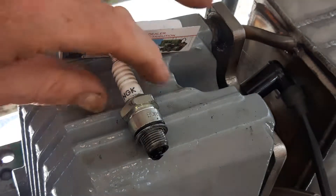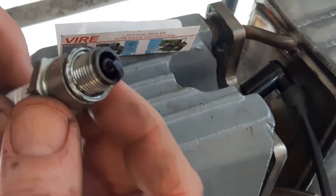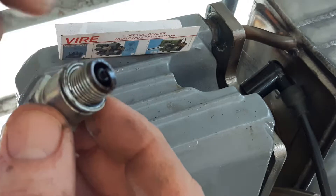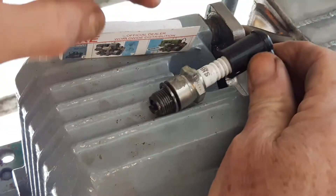I just spent five minutes turning this engine over, which had been running fine. And the NGK plug here, you can see, is fouled up. This should be fairly white, the insulator material. And if I turn this engine over now, you'll see that it will be tracking.